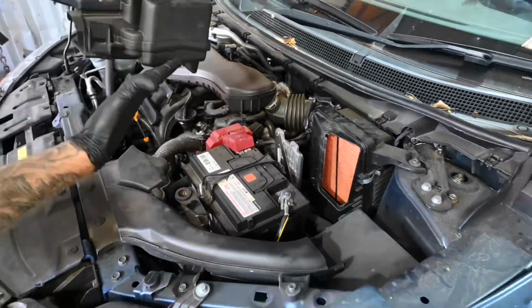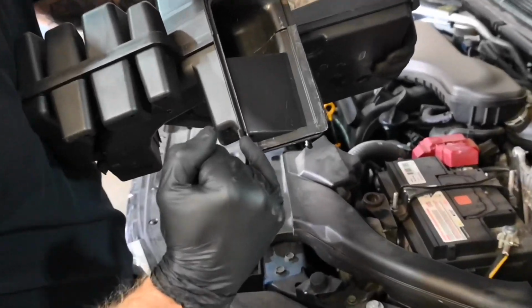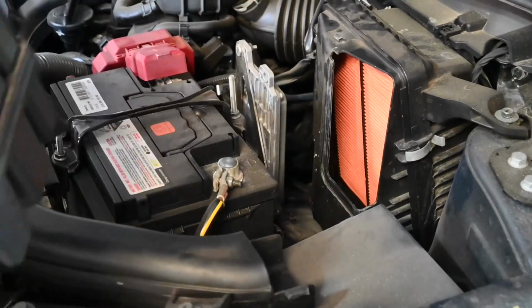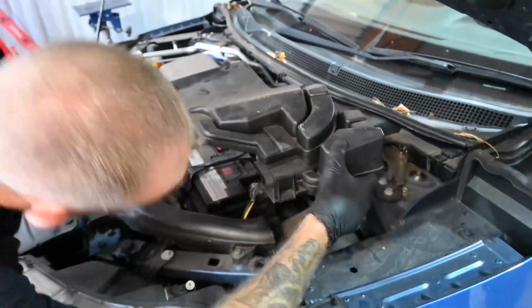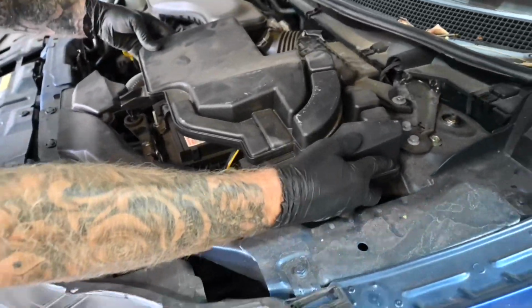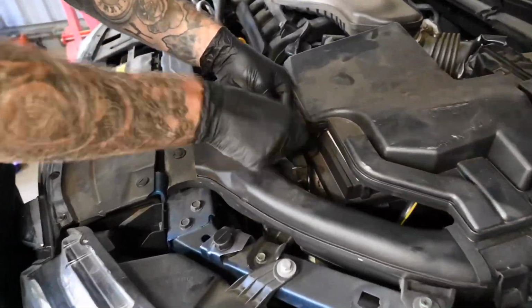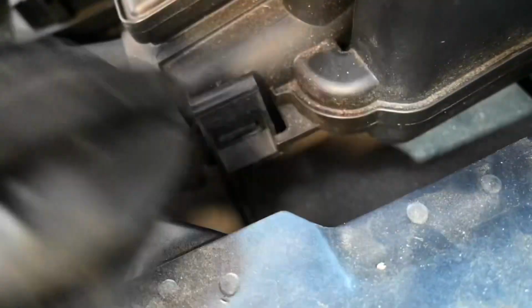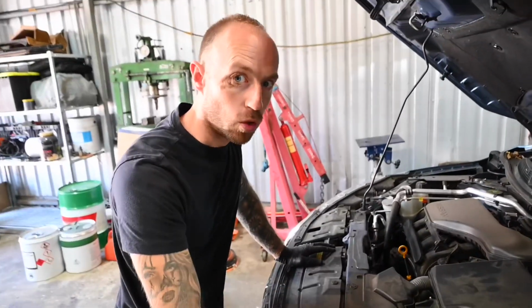And then with the large plastic panel you took off earlier, now this is where you have to be a little bit careful. There's actually a couple of guides which locate perfectly to enclose the air filter housing. So just make sure you get that started. There we are, and then the whole thing will just slide down into place. Remember just to push this front grommet into the mount, and then that side clip should pop into place. There we are. And that is your air filter all done.